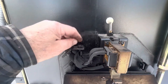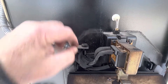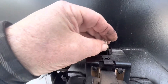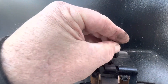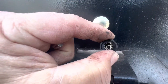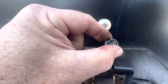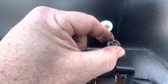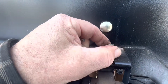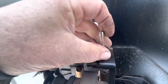That's weird. Then I noticed that the fuse was kind of a little loose in the holder here. Now whether heat's got to it, I don't know. Anyway, inside here is a spring and the spring basically was down too far. So I just took an end of a nail, cut off just the end of the nail, and it's underneath that spring. So now I've spaced that spring up maybe a sixteenth of an inch, and I think it's going to be enough.